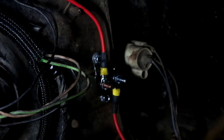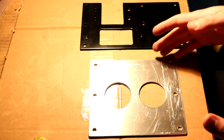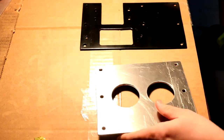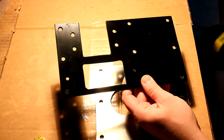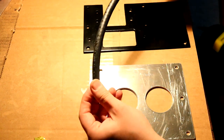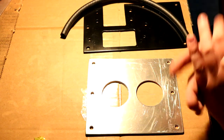This is the little circuit breaker that came in the Painless kit — this wire feeds to the battery and that wire feeds to the Painless circuit breaker in the car. I also wanted to show the brackets I designed in AutoCAD and cut out of aluminum: one for the control box, one for the Painless wiring circuit, and one for the grounds. To elevate the brackets off the chassis, I'm cutting quarter-inch rubber fuel line into half-inch chunks as spacers, which allows wiring to run underneath them.